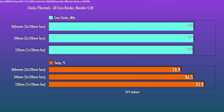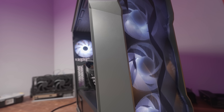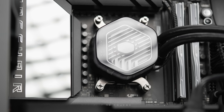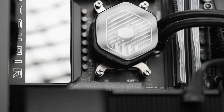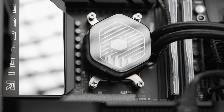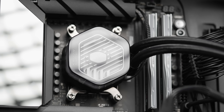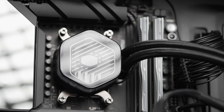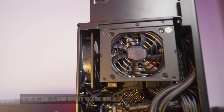With my ATX case setup, fans are intaking from the front — basically the best airflow setup you can get — but not everyone has that. If you have a less ideal setup or interference from an operating GPU, you may be in a not-so-good scenario. For an AIO you could theoretically get by with just a 120mm if you don't have the space or already have one. Between the 360, 240, and 120 options, performance is actually pretty similar — no real change between 360 and 240 — but the temps from the 120 are getting to that point where it's a little too close to comfort, or you'll see consistently loud elevated fan speeds under full CPU load. The AIO rad and pump block I'm using are very good and nearly top-of-class, so if you try to get by on a 120 you absolutely need the best unit. Really, you want to give yourself some headroom, so 240 is my recommendation.